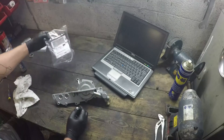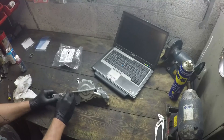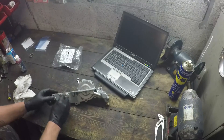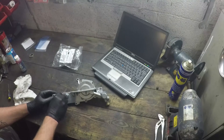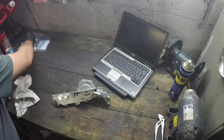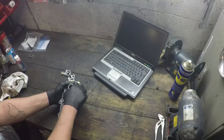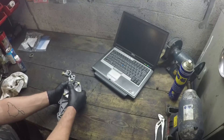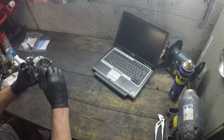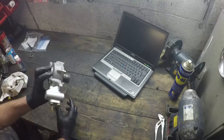A banjo bolt, which I'll have an o-ring and a washer for when I actually come to install it on the car. We've got a couple of nice new shiny core plugs for where the cam gears go — they only cost a couple of quid from BMW. The ones I had from the car had really nasty aluminium washers, so we'll just use fresh ones. That is your Vanos rebuild. One Vanos unit with a new piston — nice and tight, absolutely no play, a little bit of friction on the turn. Pretty happy with that, that's a nice job. Well done.